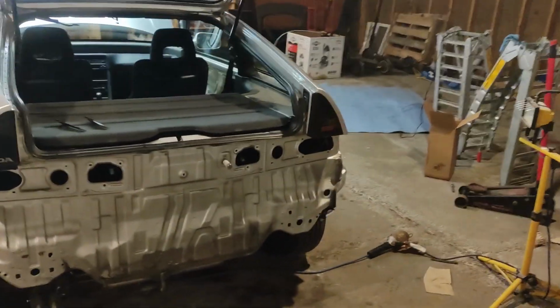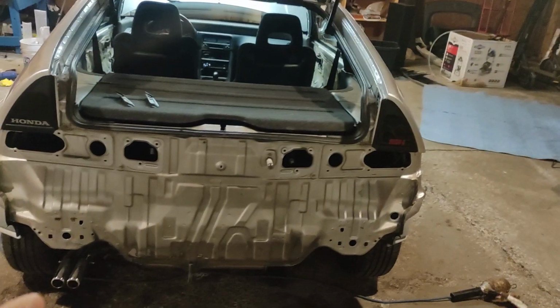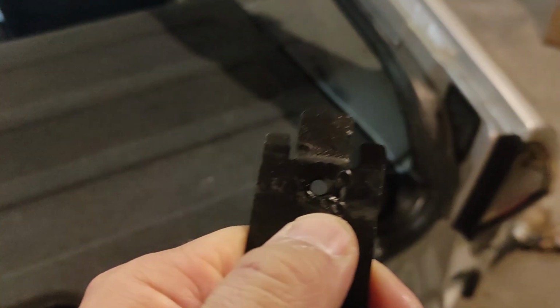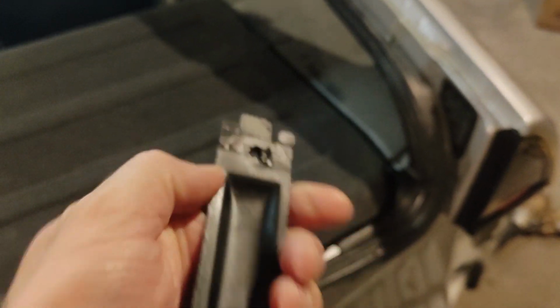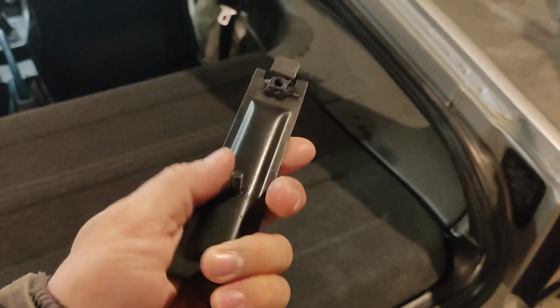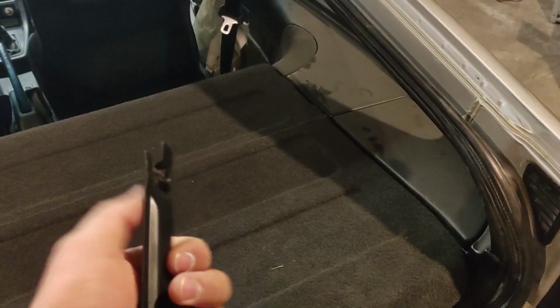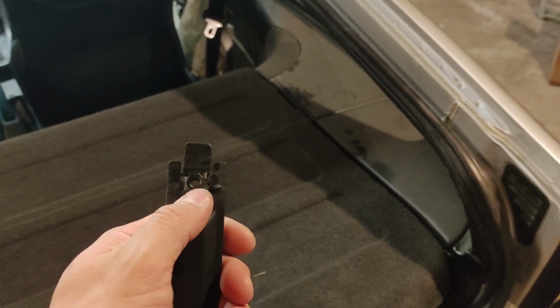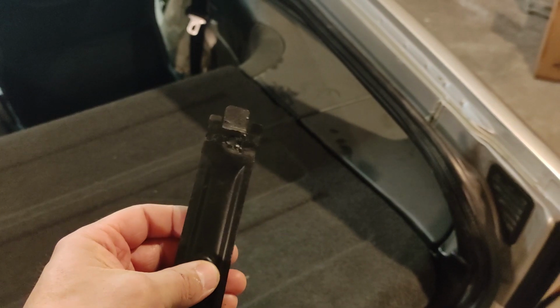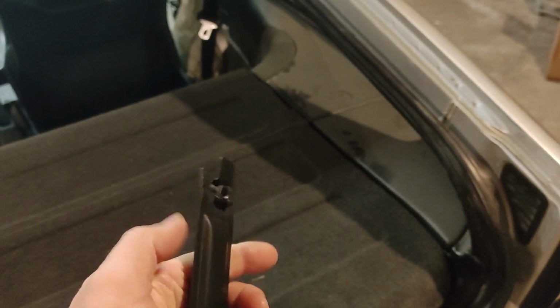I think the goal right now is to get this back bumper assembly on. I have the brackets welded and painted. They're definitely not the prettiest, but they'll work. The only part you actually see is the very bottom here, but they were quite pitted. But you know what? They're pretty good now, and there's now a nut welded on the back, and I welded the cracks that were in it. It's just thin, crappy metal that somebody was really rough with to get the plates off.